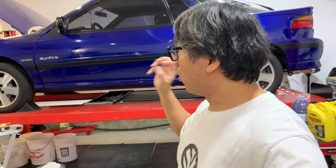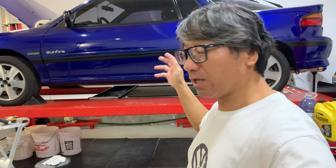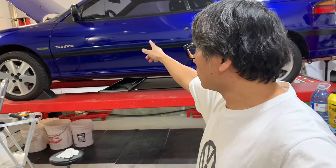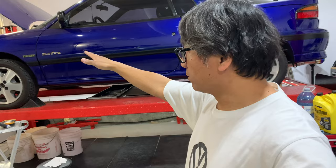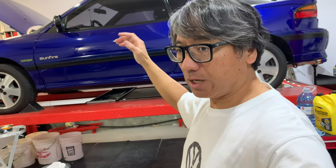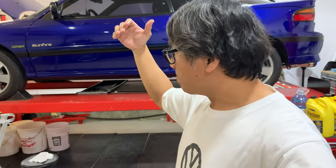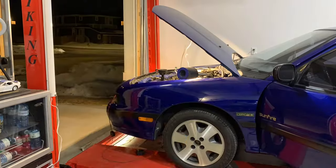of getting all our air pockets out of the engine here, so we don't get any airlocks. It should be pretty simple in this case. Basically have the heater all the way up to the highest point and fill it up until the radiator is full, and start the car until it's at operating temperature, until the thermostat opens, and basically cycle all the fluid in. And again, as the water settles, we'll add more. And yeah, that's pretty much it, guys.